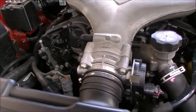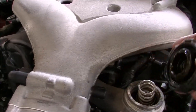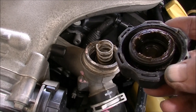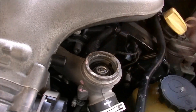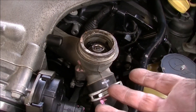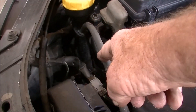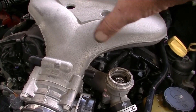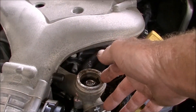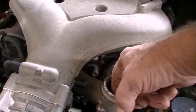Why would it be low in coolant? Well, in here is the cap for the coolant. And that's quite likely why it's overheating and losing its coolant. What it's doing is it's expelling the coolant out as it all expands - it pushes it out this overflow here, it goes into that bottle here through this hose. And then as this all cools down inside, it creates a vacuum and that pulls the coolant back in. But if it's not pulling it back in, it just keeps purging it out because it's still running hot.